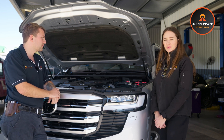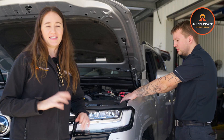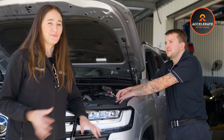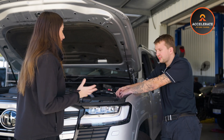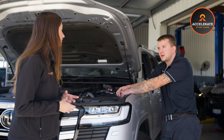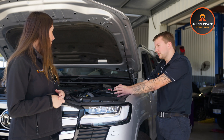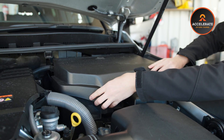Easy enough to turn it back on again, which is really handy. Another question we get asked is: my battery's got charge, but I'm not seeing any vehicle input through the app, or maybe flashing lights on the Redarc charger. What's the first sort of thing that we would look for? So the first things we look for, as always with any fault finding, is we check the fuses.